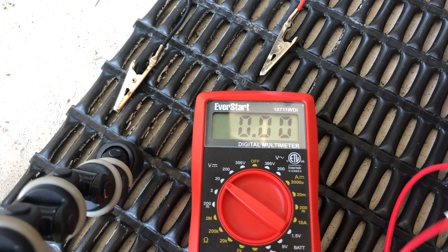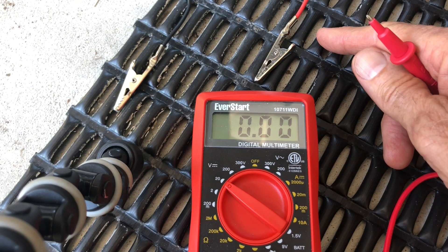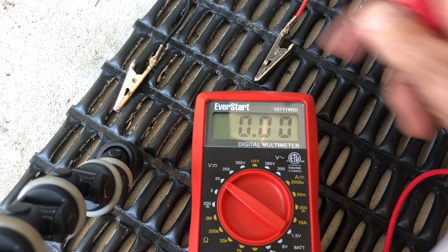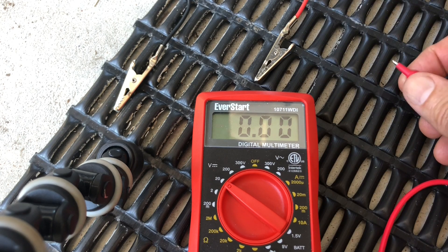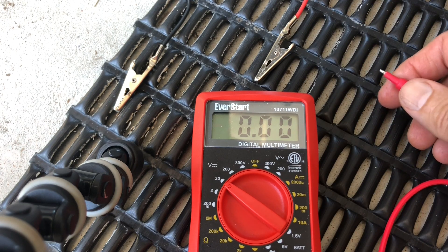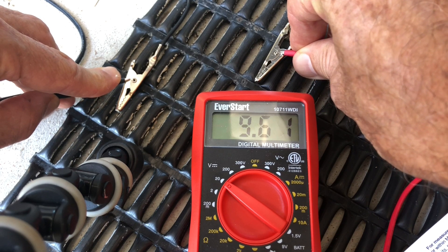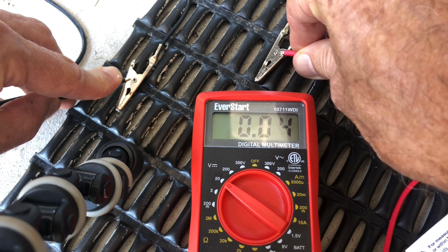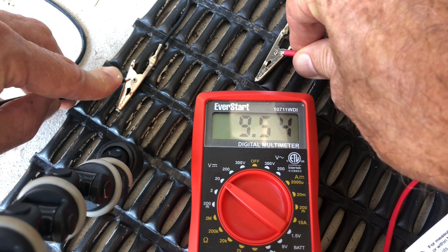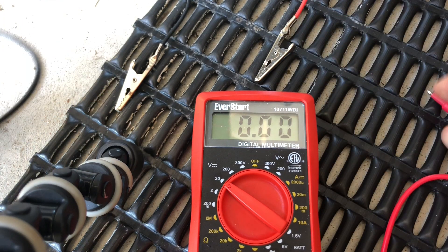You know your car has a 12-volt battery, so you're going to want to go to the function that's above 12 — the next setting above 12. We've connected the red lead to the yellow wire on the trailer and the black lead to the ground. We've turned on the signal on the vehicle. The reading is jumping around because the signal is on and off, but when it is on we're getting 12 volts — exactly what we want.